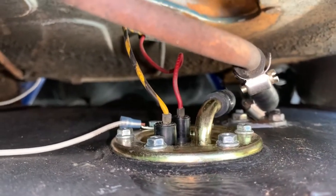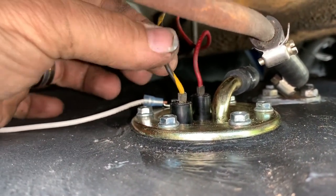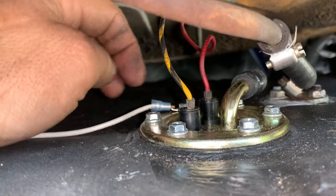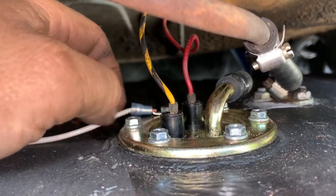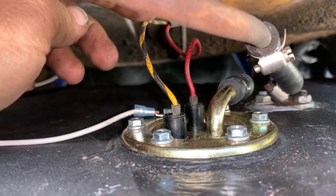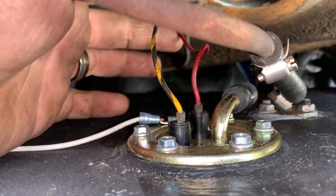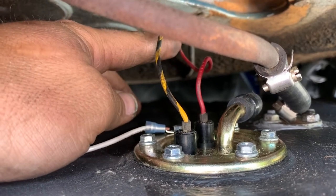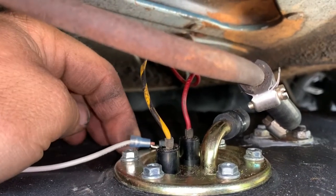We have everything hooked up here on the fuel system for the sender. This is for the gauge, this is for the warning light. This is the ground we made just to ensure that the unit itself is getting ground. Everything works there. Our resistance on the other end is working fine. Same with if we provide voltage here, it'll trip and trigger up there. Problem is we don't have power in the gauge itself. So time to chase our way through.